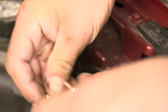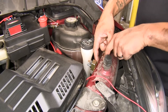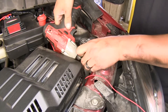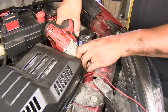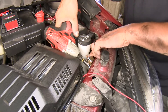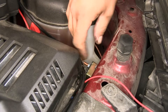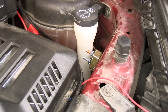We're going to mount our breaker right here on the core support — it gives us a nice solid piece of metal to go into. We'll take our self-tapping screw and a 5/16 nut driver and go right into the core support. Make sure you leave yourself enough room to get the other self-tapping screw in on the other side. Leave that one a little loose so we can still turn the breaker over and put the other screw in place.